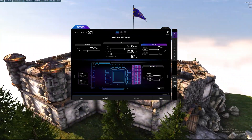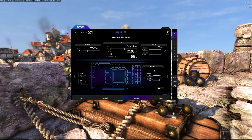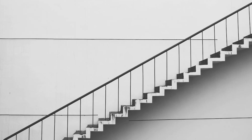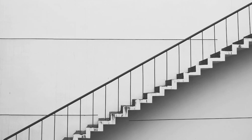The second thing is the frequency curve of the video card. Before in the last series, when it hit a temperature that was too high, the frequency would automatically drop — say 100 or 200 megahertz — to compensate. In this new generation, the video card will curve its way down slowly instead of dropping drastically step by step. Before it was kind of like stairs — walking up or down stairs. Now it's more like a smooth incline. You don't have to worry about drastically lower clock speeds just because your temperature has risen.